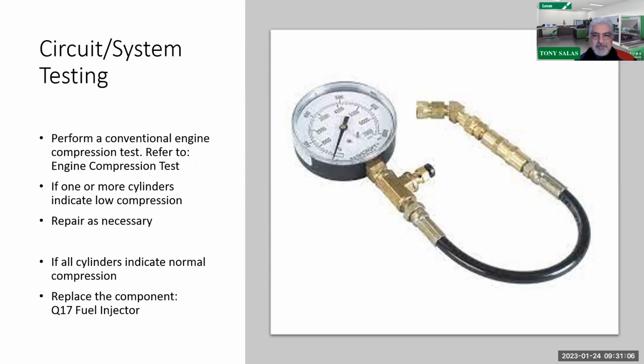But you know what I think it is? It's actually something we've been seeing in Duramax ever since its birth from LB7. You know what it is, especially in the high mileage L5Ps and L5Ds, is your valve lash adjustment. Going back to the balancing rates, okay, those of you who know balancing rates, have we not seen balancing rates affected by excessive valve lash on the valves and rocker arms?